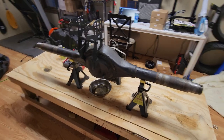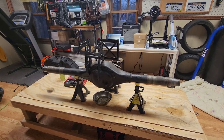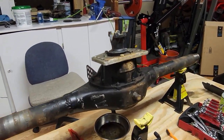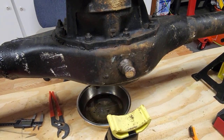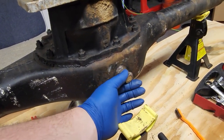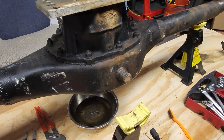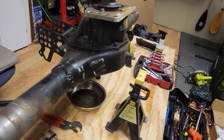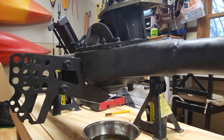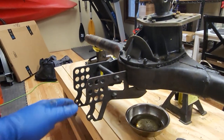We got her pretty much stripped down — those inner races were defeated by the BFH. BFH is two and oh on the night, still undefeated. We did run into another problem: the drain plug on the bottom of the center section is a little beat up — it's been riding around underneath a dirt car for who knows how long. It developed a little lip on it and I couldn't get the socket on to take it out. We've got some files to file the faces down so we can get a socket on it, but for the time being I'll just drain it out of what is technically the back, then we'll file down the bottom plug and get it out before we start whacking off these big pull bar mounts.